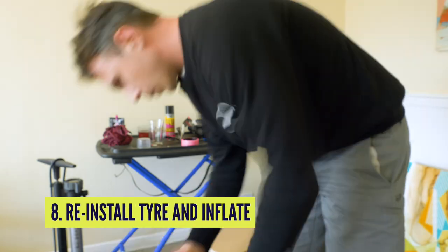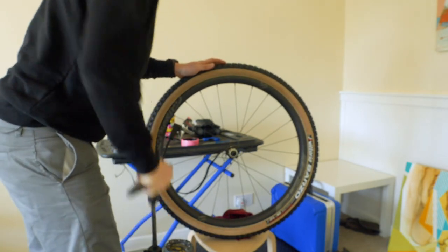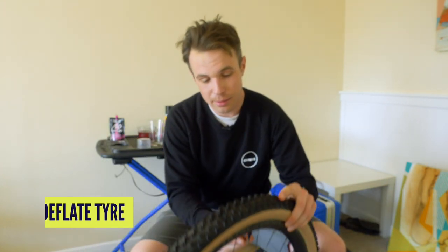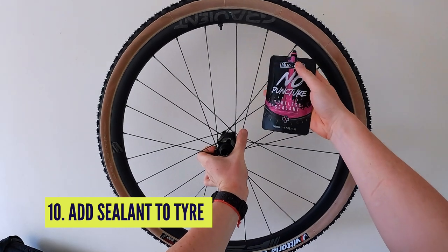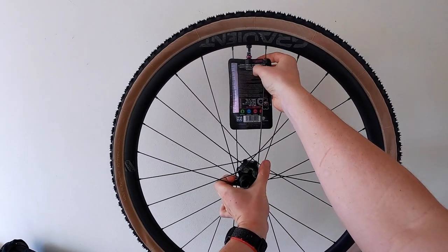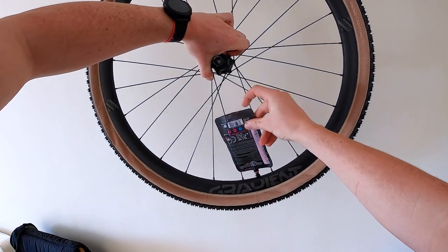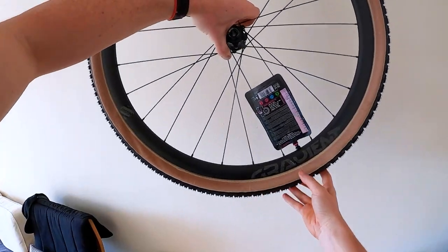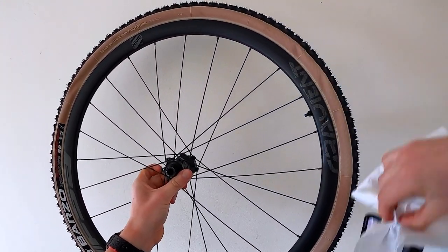Now that the tire and rim are both cleaner than a new one, we're going to put them back together and get the tire seated by inflating it. But we're not going to add the sealant yet. Now that your tire is seated all the way around on both sides, we're going to undo all your hard work by letting all that air straight back out and removing the valve core. Now it is time to introduce the sealant — if you're injecting it through the valve like me, we want to connect the sealant packaging at 12 o'clock, insert the sealant into the rim at 6 o'clock using the guides on the packaging to measure it out, then remove it at 3 o'clock. For you digital clock lovers — well, not so clever now, no handy metaphor for you.